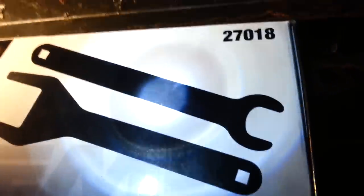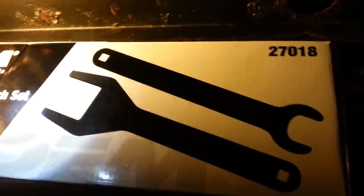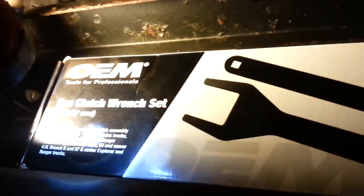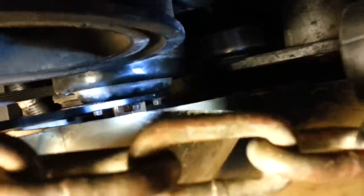One thing that works out good: if you've got an AutoZone nearby, you can buy this tool kit — I think it's like $27 — and as long as you don't damage it, you can take it right back and they'll give you a full refund. The part number is 27018, and you get a 36mm and a 57mm wrench. The four bolts that hold the water pump pulley on are still up there. I backed them out about a quarter inch to get the wrench slid over the threads, then snugged them back up so the wrench holds itself in place.